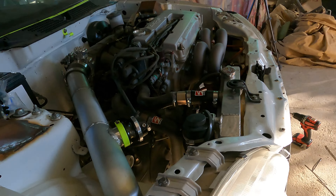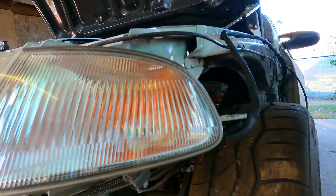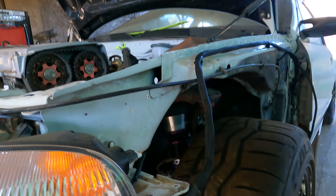So here is the finished product. Here's the right side marker, the harness under the headlight, city light. And then it runs through the top of the intercooler. I've got it all bunched up right here, zip tied up. Mounts through the top, goes in through the door hinge. And here's the left side marker. Pretty happy with this. Basically at this point I just have to clean up the inner harness, which I'm not looking forward to, but I got to do it. We got a fully functional harness. This install is done. Super excited about that. I'll put the bumper on and the front end on later. Just got to figure out some connectors here and that'll be done. Everything's fully functional.